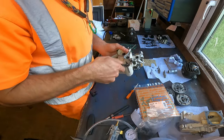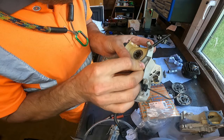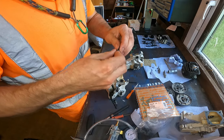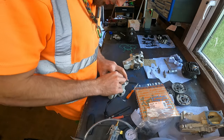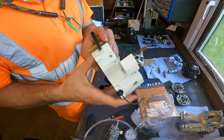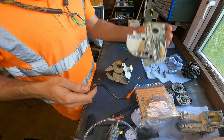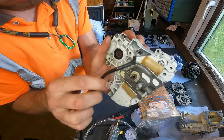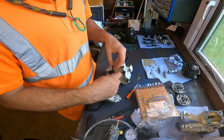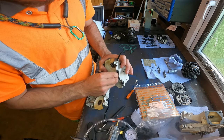lead for the ignition coil and spark plug. So we'll push that again, push that through that black little rivet where that black pipe's just come from. Better if you bend this a little bit, get it a bit straighter and just push that down there. Yeah, so that's coming through. Actually, no, done that wrong. Need to push it through this side first. Little hole here, right there. It just feeds through first before we do that. Now we can push it through here. Through this hole.